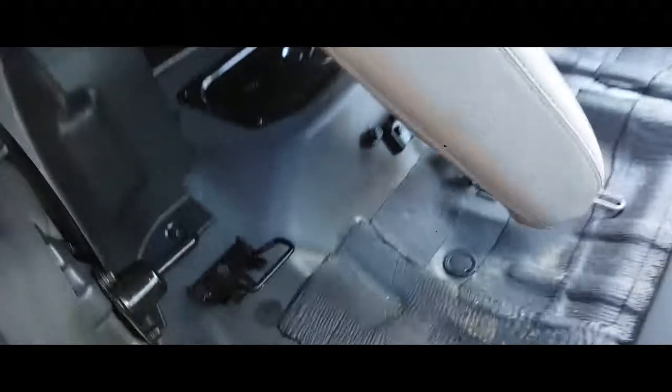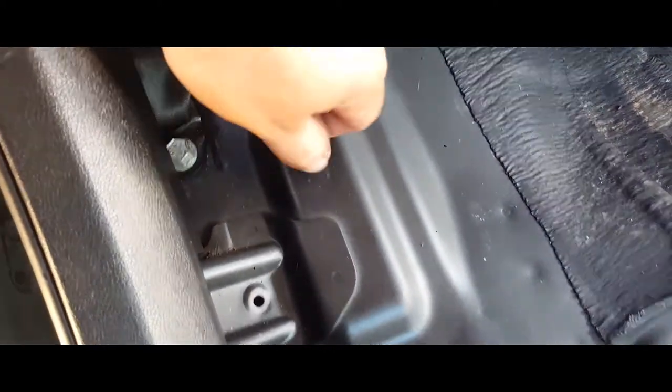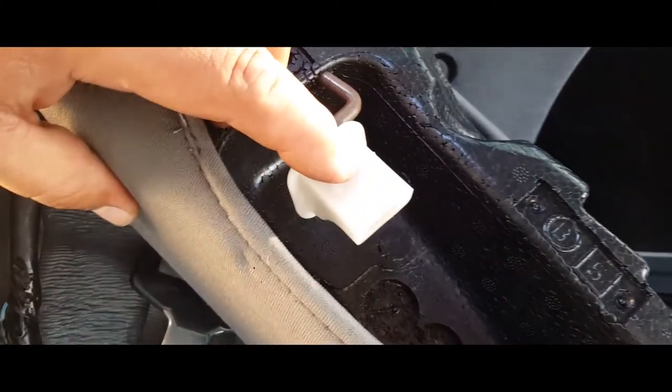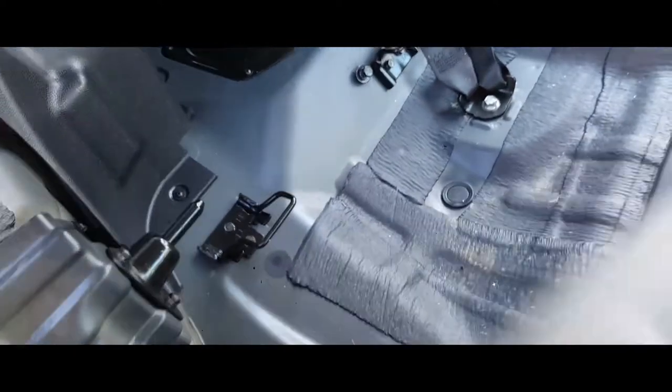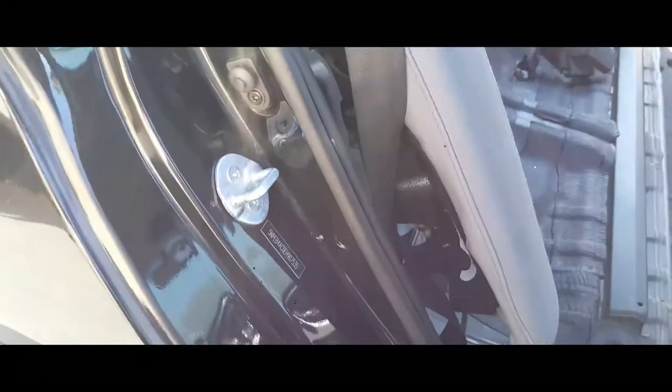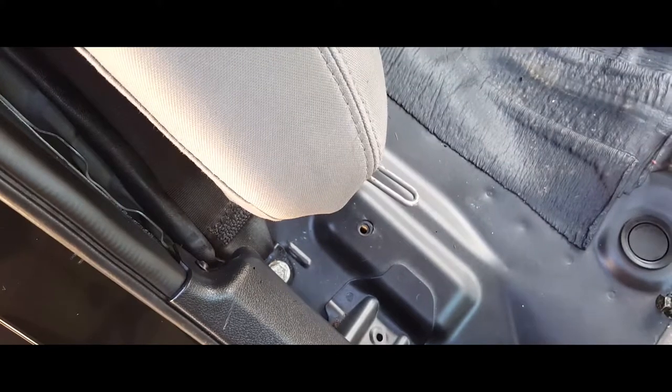The way this is going to go down is you have one screw that holds it into place. I left it there so we don't lose the screws, so I'm going to remove it. This piece here is going to latch into this socket. The way we're going to do this is we're going to pull the seat belt forward and place this in here. You can see how this back piece goes right in there, then it sits down and latches right in there, or you screw it to secure it.